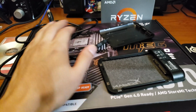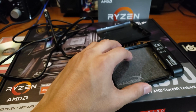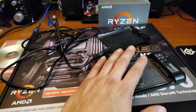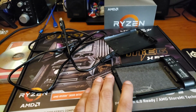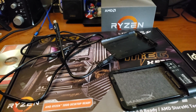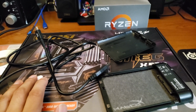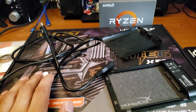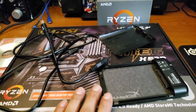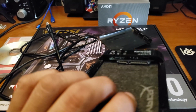Another device you actually might need is one of these little external enclosures. You can actually plug in the SSD drive or the other drive that you're going to be installing Windows 7 on, and connect it to another computer. Now, if you don't have one of these, not a big deal. You can always take your destination drive from Windows 7, and actually piggyback it on another computer. And this will be really useful when, once you finish your Windows 7 installation, you can actually physically move that drive over to another computer and copy all the files, such as the chipset drivers and the other files I mentioned as well. This actually can make things a little easier.